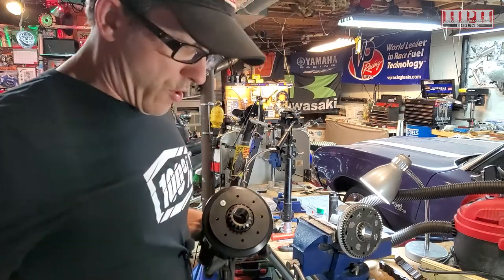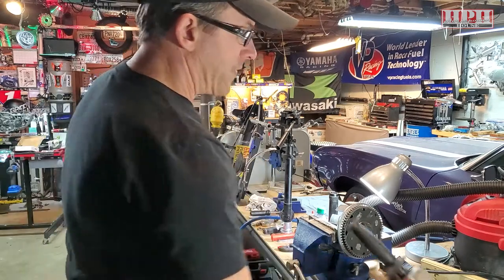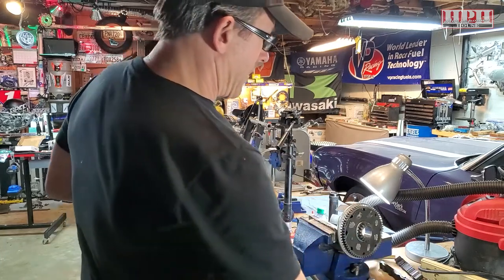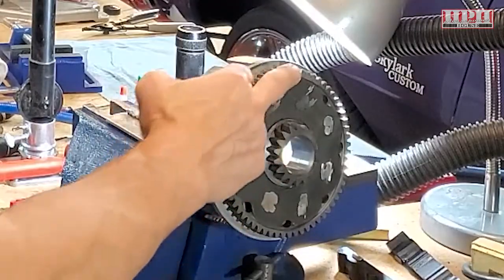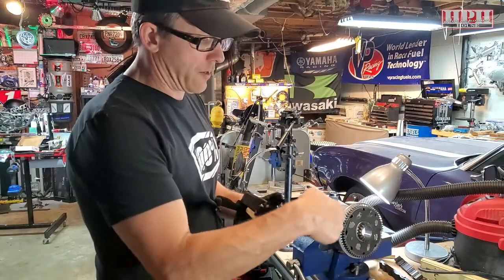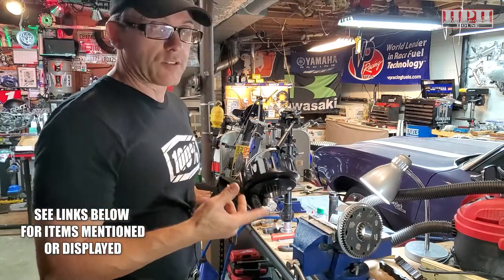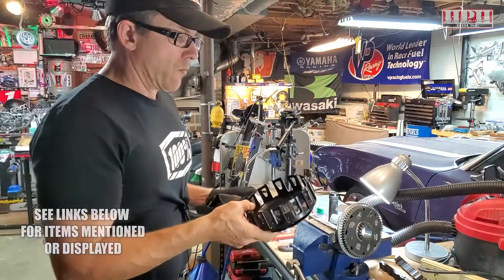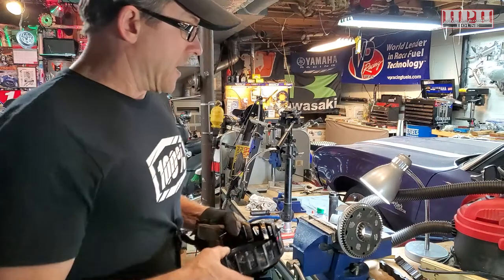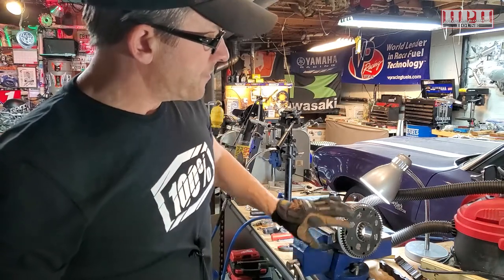Let's show you how we're doing it — it's also the recommended method. You're going to need an angle grinder, a powerful one, and you're basically going to grind off the ends of the pins that hold that kickstarter gear on. Then it will be transferred over to the new one. We're going to install a Wiseco complete clutch kit, which is kind of rare — it's not Hinson, it's not Barnett, which are the common brands, but one of our suppliers offers Wiseco parts at good prices. So we're going to grind off the last rivet and show you how that's done.